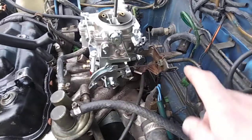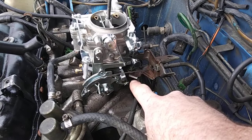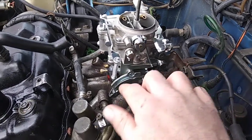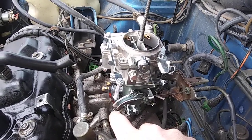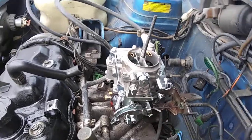I'll show you what I did on the side. I took the existing coil bracket and I punched it out and turned it and ran it through the mounting stud for the carburetor. And then you have to drill this out — this hole's too small for the end of the cable, so you've got to drill that out. I think it was 5/16 or a little bit bigger than that.